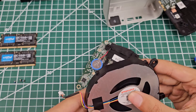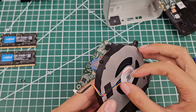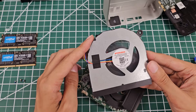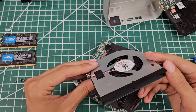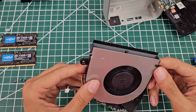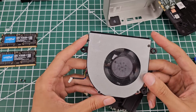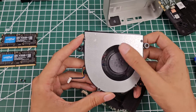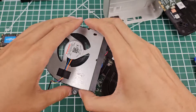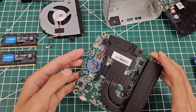I don't see an exact fill port — there might be one under the sticker. For people looking to lubricate this fan to help reduce noise in the future, you're probably going to have to disassemble the fan by breaking these clips, peeling off the top plate, and popping off the top fan piece to reach the bearing inside. I'm not too eager to do that right now — I assume this is as the system was intended.